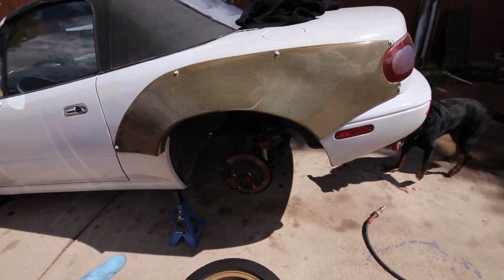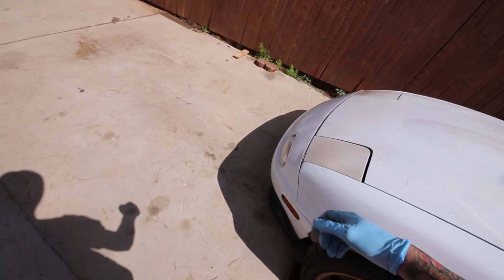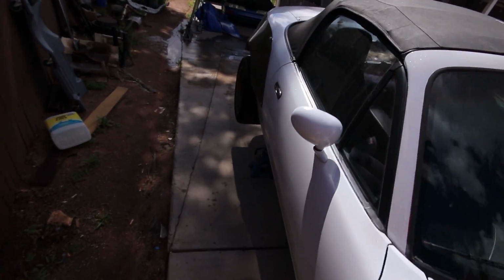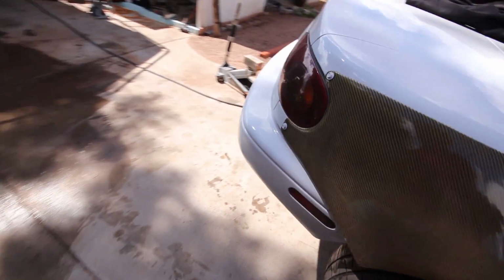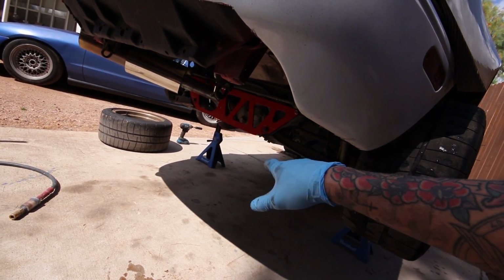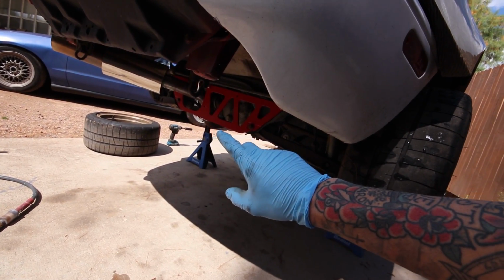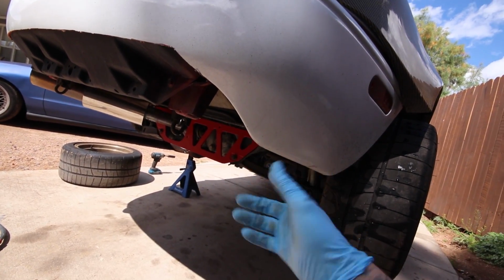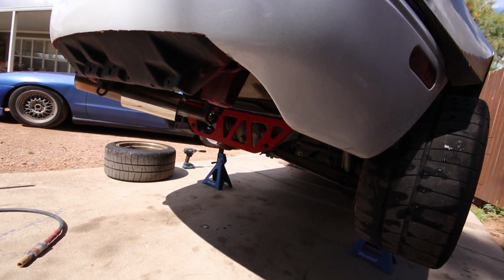Got the car jacked up, got the one wheel off, gotta take the other one off still. So yeah, it's pretty straightforward now that I know how to do it. Just drop the power plant frame, which is just a few bolts, knock the washers through, or the studs or whatever they are, undo this back part of the exhaust, undo the axles, and then undo the drive shaft, and then just undo the diff carrier bolts, and it'll fall right out.